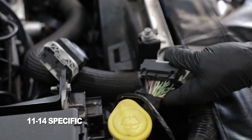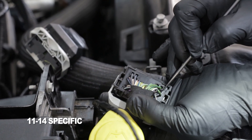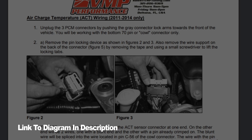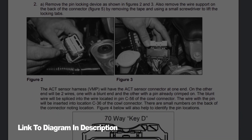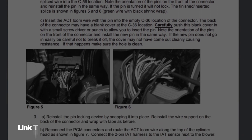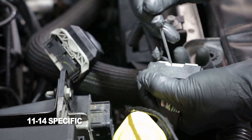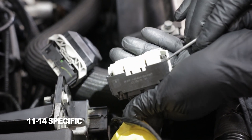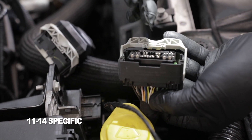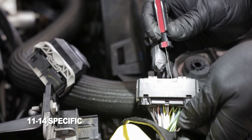Go ahead and take off the wire support and remove any tape that holds it on. We're going to identify pin 56 first — we'll also throw a diagram up on the screen for you. Now that we've identified pin 56, we want to go ahead and take off the connector retainer, the white piece on the front side of the connector. Then use a pick or a connector tool to release the detent that is holding the pin into the connector.